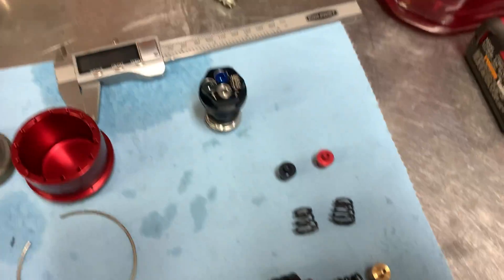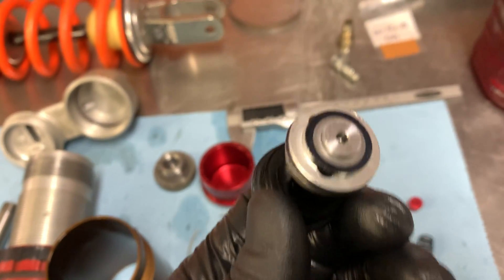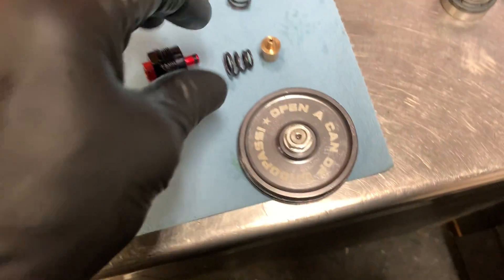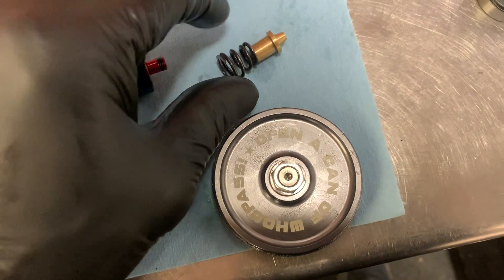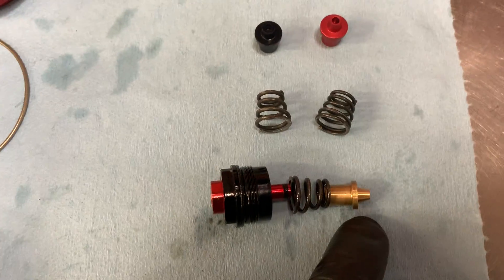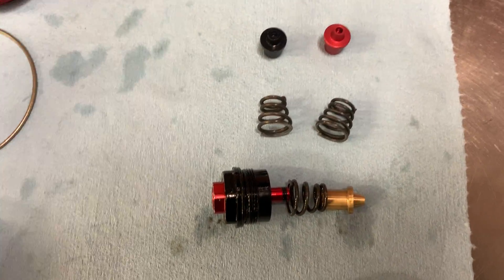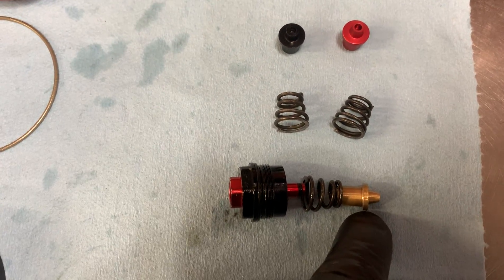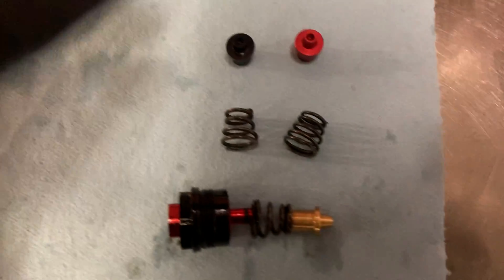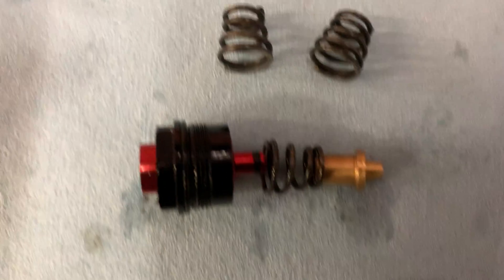We have two different oil circuits. When you have a very large or square edge bump, root, or rock with a lot of shaft speed, you need to move a lot of oil quickly — you can't move it fast enough through the piston and shim stack alone. That's why we have a spring-loaded check valve: a tapered needle that opens or closes an orifice. The red adjuster adds more or less preload to that spring, changing the point at which the needle moves away from the hole and allows oil to bleed into the reservoir. We have different tapers of cones — soft, medium, and hard — which give more or less leverage with oil flow, plus different rate springs on the high speed adjuster.